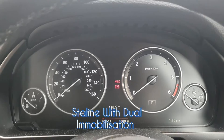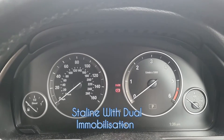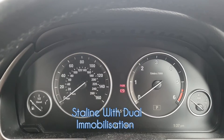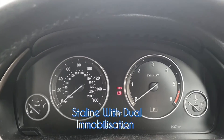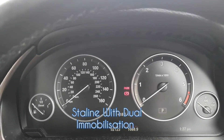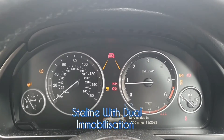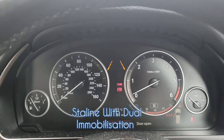First I'm going to show you the digital block-in, and then when I've finished the installations I'm going to show you the dual block-in called the analogue block-in as well. How it works is: if a thief was to grab the key, jump in and try to start it, they'll be able to start the vehicle but as soon as they select a gear the vehicle will switch off.